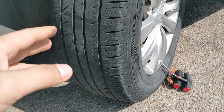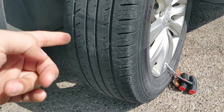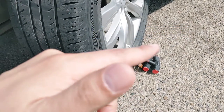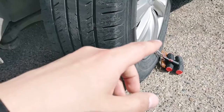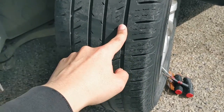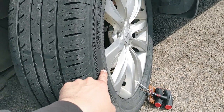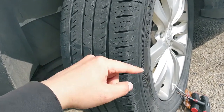If your tire's warranty expired and you don't feel like spending extra money to get your flat tire patched up, a plug kit tool is a must-have to repair your tire. The only places you should be plugging a tire is within the crown of the treads — you don't want to repair any holes in the sidewall, as they're not reinforced with steel belts as much as the middle treads are.